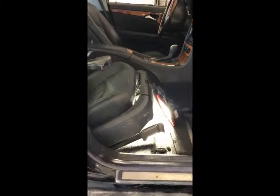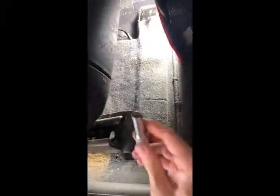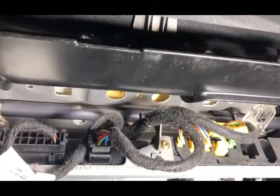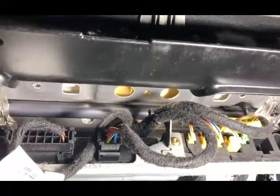Next I used another YouTube video to see how to take the front passenger seat out, because it's very hard to reach the cables you have to deal with unless you remove it. I unbolted the bolts from the rear and from the front — they look like this. The inside Torx socket that you need looks like this; it is an E12. This is the underside of the power seat tipped up after I removed the bolts in the front and the back.